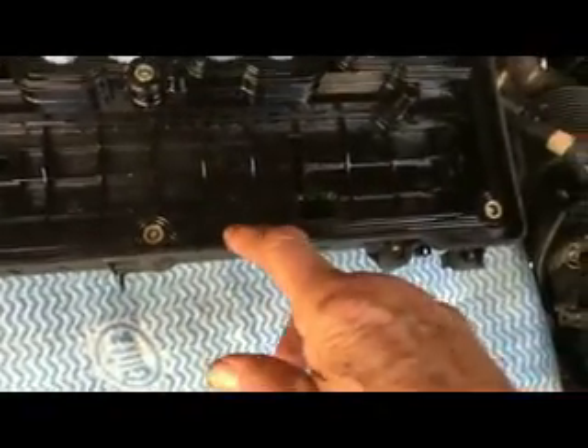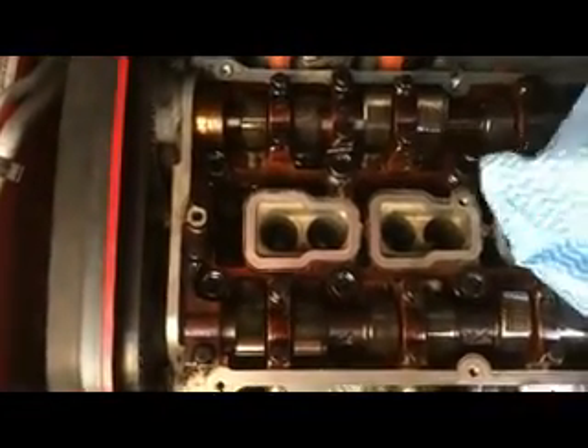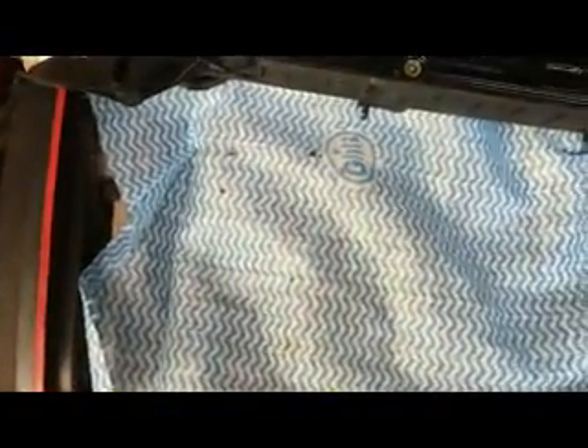The gasket is quite large - it goes right across the middle here and back around. It's very large, so you need to have your new gasket ready. You need to clean all the faces, wipe all the faces where your new gasket is going to sit, right around the whole area. Remove all the oil and dirt - make sure it's all flat and ready for the new gasket.